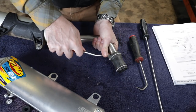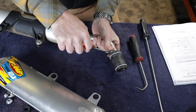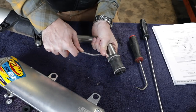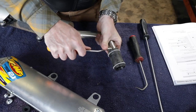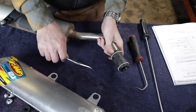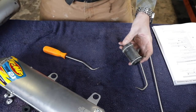When removing a rubber hose from steel, especially if it's been on for some time, keep a little bit of down angle on there, go around and free it up to get it off without ruining anything. That couldn't be simpler right there.